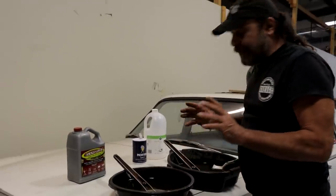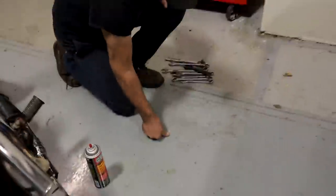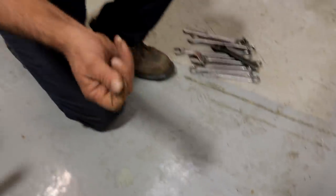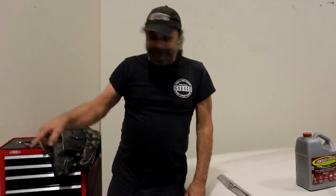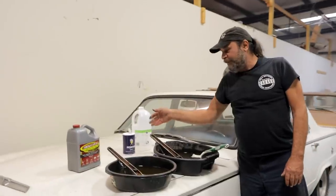What I did notice is that one downside of the Evapo-Rust is that any place where it splashed, it left a gummy film. It says it doesn't damage paint, plastic, or anything like that — and I'll go along with that — but every place I was, every footprint, it left a seriously gummy film. You don't get that at all from the vinegar. So if you splash it around as you go about your business, you're going to have some serious cleanup. And I don't know if I want that film sitting in my gas tank. So for my money, I will definitely stick with my old standby — white vinegar and salt.